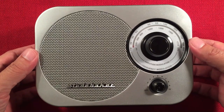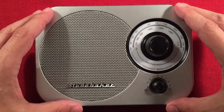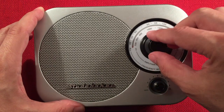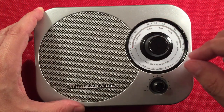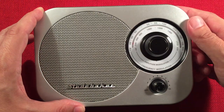So, okay, FM reception. Let's talk about that. The reception report: sensitivity was okay to good. Kind of right there with my analog radios. I know it's because of this antenna. This is a DSP type unit. You can hear it as you step, and you'll notice it on the AM band when we go cruise that. It has a little distinct ding, ding, ding, ding as you're doing your steps. So that little antenna, I think, affected its reception.